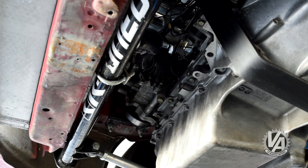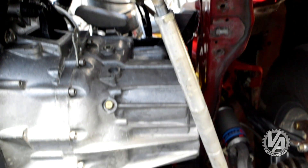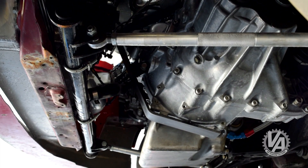To fix the suspension flex, there are traction control bars — this particular unit is made by K-Tune. The lower control arms are mounted in rubber with a strut bar going from the front to the lower control arm. This eliminates a lot of the flex you'd normally find, which is important on a drag car because you want it to track as straight as possible and not have the tires trying to drive towards each other down the strip.